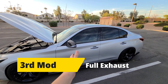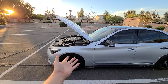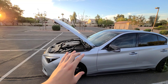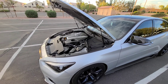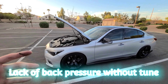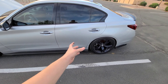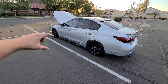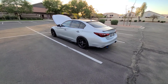If you're not going the JB4 route, the third mod is upgrading the exhaust: upper down pipe, lower down pipe, Y-pipe, mid pipe, and axle back. On the VR30 platform you have an upper and lower down pipe, or you can get a full down pipe that combines both. I have an AMS 3-inch lower down pipe with a Megan Y-pipe going from 2.5 to 3 inch, and a 2.5-inch cat-back with one resonator in the middle.